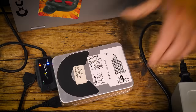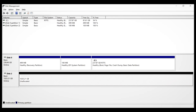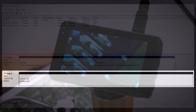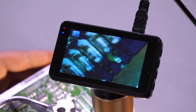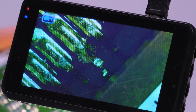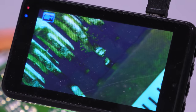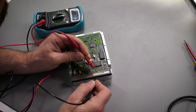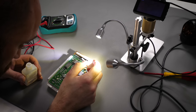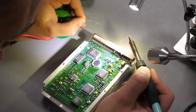Let's talk about the hard drive because I have news. When I previously checked it out it was showing the wrong capacity and there was no readable partition on the drive. Well I took a closer look and noticed something on the connector under my microscope: a single broken joint which when tested had no continuity. It could be why the previous owner gave up on the machine, or it could just as easily have been me removing the cable heavy-handedly. I brushed on some flux and then bridged the break with a stroke of solder - it really does feel good to have the soldering iron back out again.